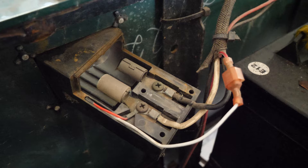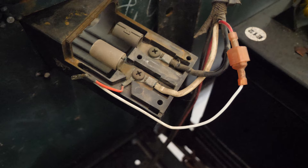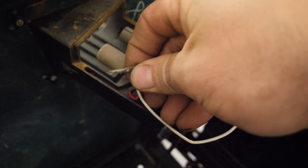Now what you could do is you can eliminate this white wire and jump it off to the screw here and be done with it, or do it over closer to the battery pack if you really want to. I don't suggest that you do that — I suggest that you put a new reed switch in and do it the right way. But these little ones are expensive.